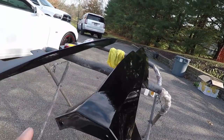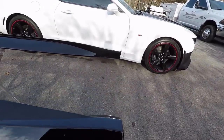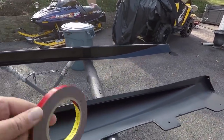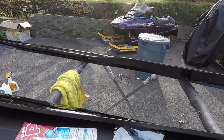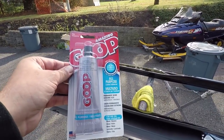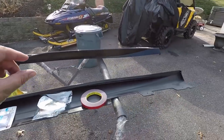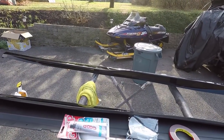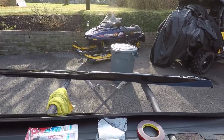The way the skirts go on the car, there are some screw holes on the back and along the bottom where the self-tapping screws provided in the kit will go up into the plastic rocker. On the top side they give you a couple of options: you can use the two-sided tape provided and run a strip along the top for a quick and easy stick-on application, or for a more permanent installation — recommended by American Authority — you use Goop all-purpose contact adhesive. The trick is don't use a thin amount. Put a whole bunch along that top edge so it squishes out the top, let it set for about an hour, hour and a half, then pull the big bead off the top and you'll have a really clean, direct fit onto the car.